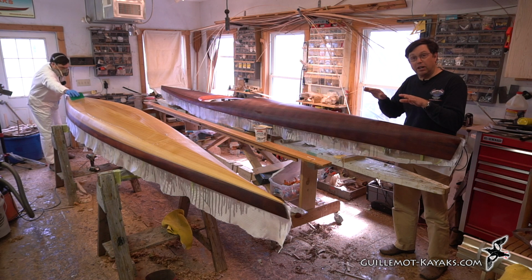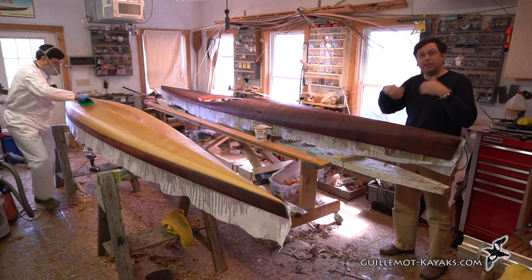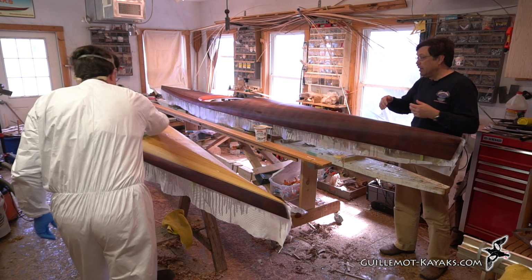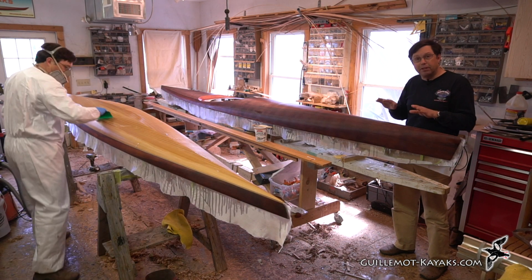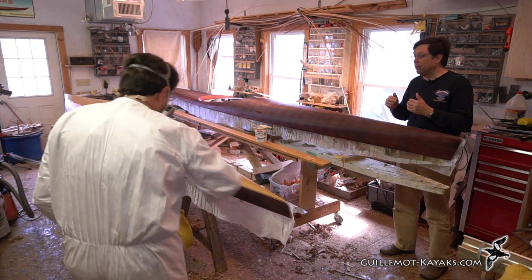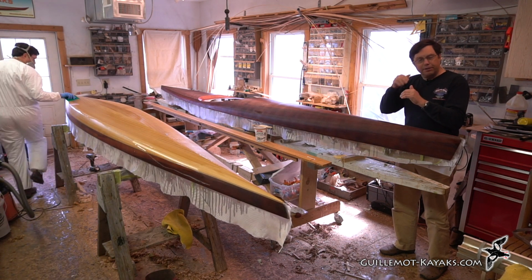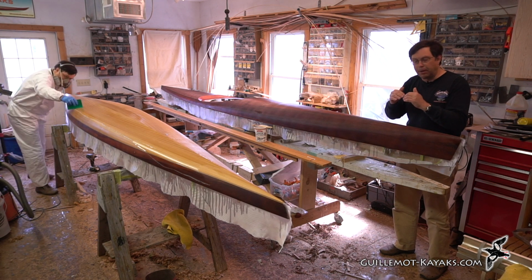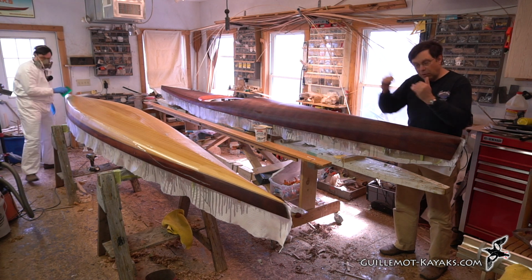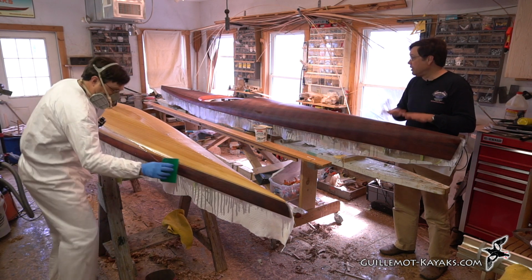And that's all I'll do on the hull, because later on, after I attach the deck and the hull back together again, I'm going to put another layer of fiberglass from the hull up onto the deck a little bit. And so I want to have the weave filled in so I can sand it without sanding the weave. If I left it without any fill coat, the divots in the weave are quite deep, and sanding in there, you can't sand. So to get a good mechanical bond is hard, because it's going to be glossy down in those divots.